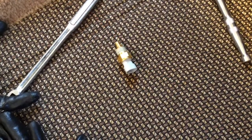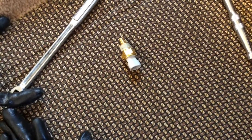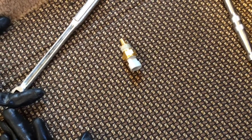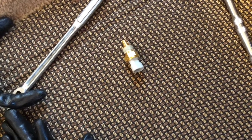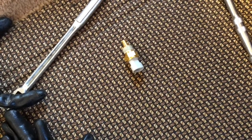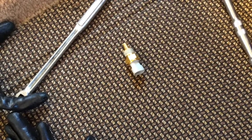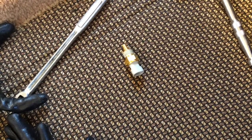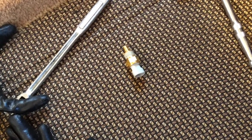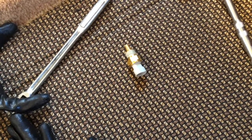Okay, now for the next project. Steering does seem to be better, but I've still been having the issue with the horsepower dropping off after you get over about 1/4 throttle after the engine gets warmed up. I finally have realized that when it's cold, the engine seems to do fine, but once it starts getting warmed up, that's when I start having the loss of power at anything over 1/4 throttle. It just doesn't respond like it should.